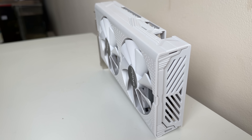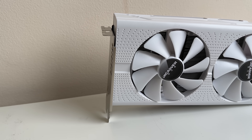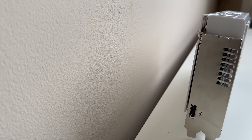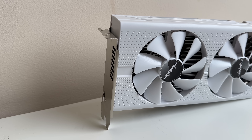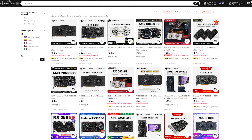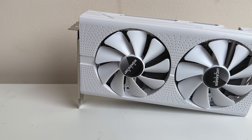Overall, the 16 gigabytes of VRAM can actually be used in games and does make a performance difference. The problem is the RX 580 GPU itself can't handle games at very high settings at 4K, and only those extreme settings actually use this much VRAM — which makes it seem somewhat pointless. This card costs about 30 to 40 dollars more than the 8GB version, so it's hard to recommend it for gaming. Maybe there's a mining application or some other use case — let me know your ideas in the comments. Thanks for watching!